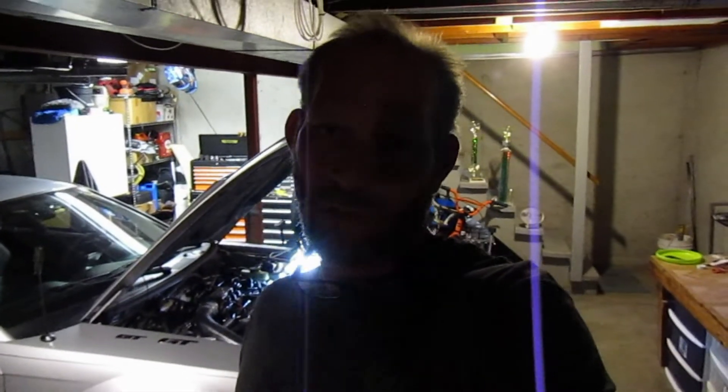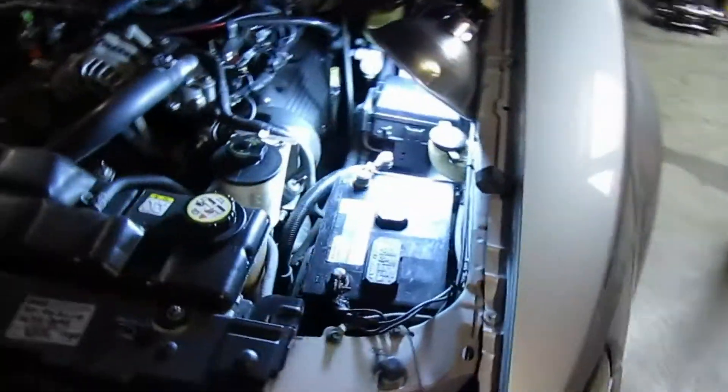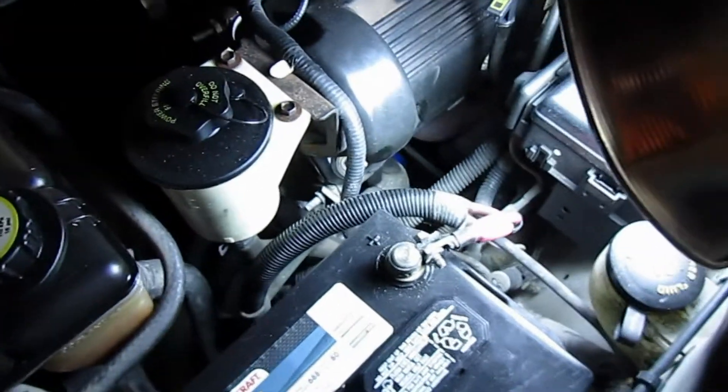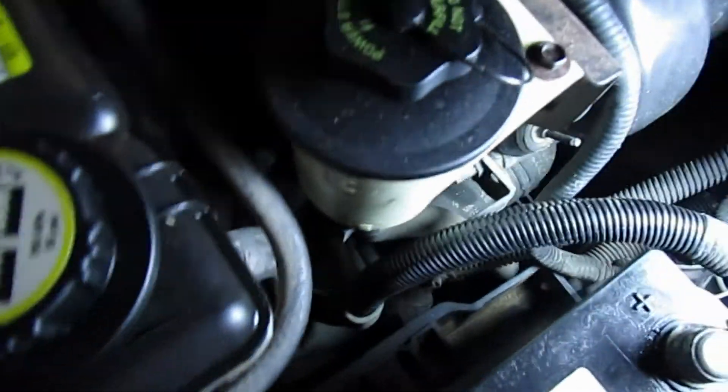As we may or may not know, it's not a fully functional gauge — it's basically just a switch that sends the gauge into a medium state and says you have oil pressure, you're good. I'm going to bring you over here and show you what the actual situation was. I changed the oil pressure switch first, which is the first thing you should check in all cases.